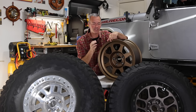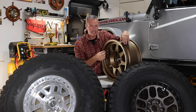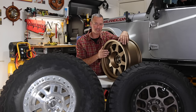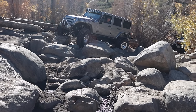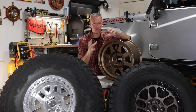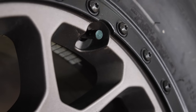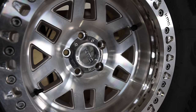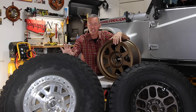Another thing to consider is the valve stem. This wheel has a pretty traditional valve stem placement with a small cup that protects it a bit. I'm a huge proponent of rubber versus metal valve stems — I once went to pick up my tires and they put metal valve stems on, and I said that's not going to work. Rubber is flexible, so if you hit it on a rock it bends rather than cracks. The Mopar wheel has a really good protection cup around the valve stem that almost covers the entire thing. The KMC beadlock wheel actually has two valve stems, allowing you to use a gauge to check tire pressure while airing up or down — usually for race applications.